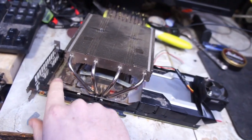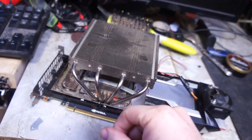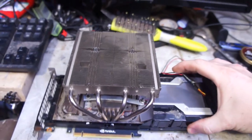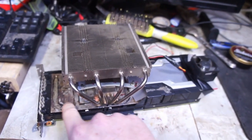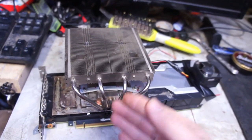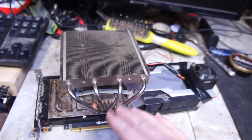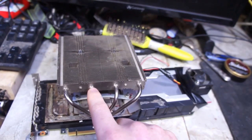This plate is what originally had the fin stack on top of it. I threw it up on my gas stove, full blast, and just used a butter knife to lift the heat sinks off — there's another video on the channel about that. I didn't have great contact with this cooler against the heat pipes that were there; I wasn't even expecting heat pipes to be under there. I tried to solder a piece of copper on top, thinking even if it's not full contact, solder would make good enough contact to transfer heat well — but it wasn't making it to the cooler very well.